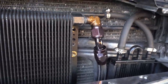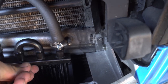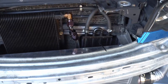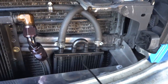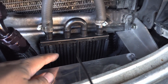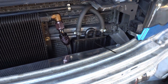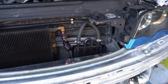I've got the lines routed for my power steering cooler, and I need to finalize the mounting. I'm not too set on this tie — we'll see. I'm going to leave it anyway, just in case I need to take out all the cooling stuff; it's a lot easier if I can get out the condenser. For those wondering, the reason I have it so low and kind of behind the intercooler is because the space behind it is all free space. If I mounted it towards the middle, this brace would basically be blocking it. I wanted somewhere where the air can flow through it. I don't really expect it to make that much of a difference, especially for power steering, so I'm just going to leave it like that.